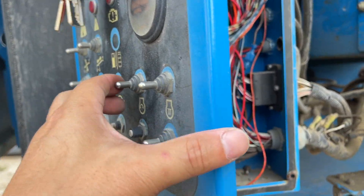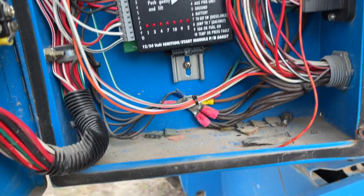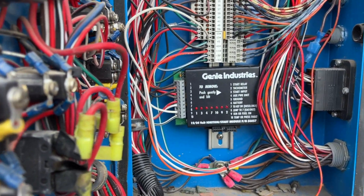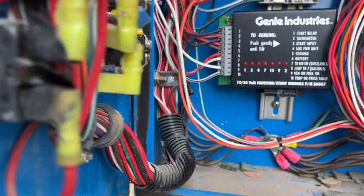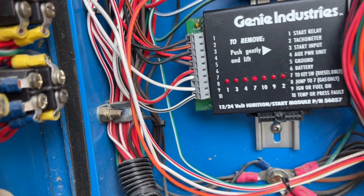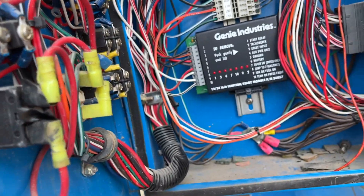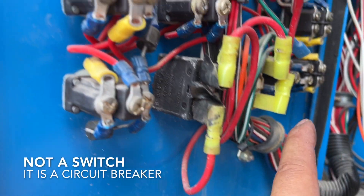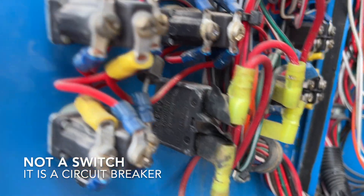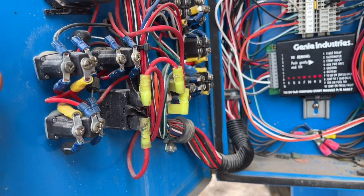And then I can start it just fine. But wait — looks like I'm having the same problem again. Okay, it's back on. Yeah, as I was creating the video I was playing around with that switch and sure enough the light turns off and it won't crank. Now it's back to bright light but still won't crank. That switch definitely needs to be changed because it is so finicky — just by touching and pushing the terminal up and down it would allow the engine to start or not start. Pretty crazy.